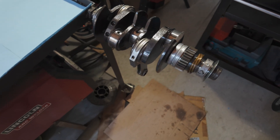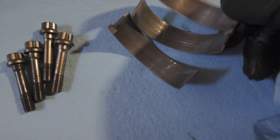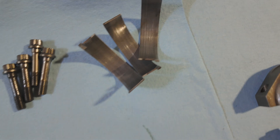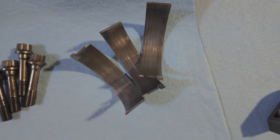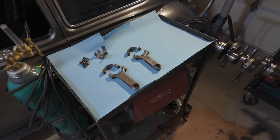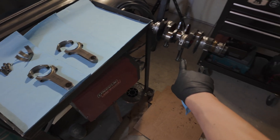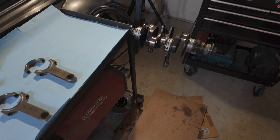I had to take the crankshaft out of the engine case — it's gonna be a lot easier to replace the rod bearings instead of keeping the crank in the case. My little setup here on my welding cart, here's rods 1 and 2, here are the bearings. They got some wear on them but I could have still ran that. So let's go ahead and replace all the bearings — I'm gonna start with these two, this is 1 and 2, and I'll start with 3 and 4 that way I don't get any confused.